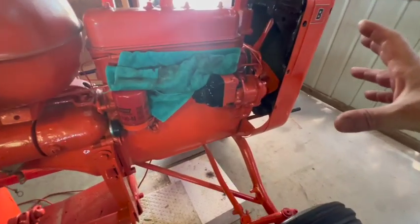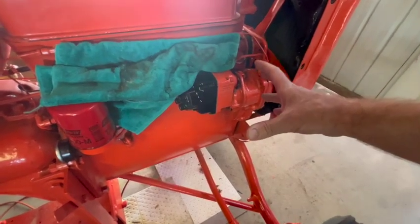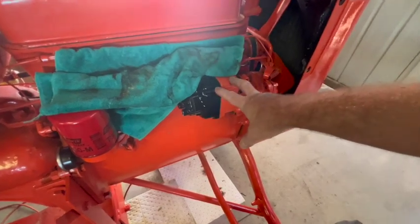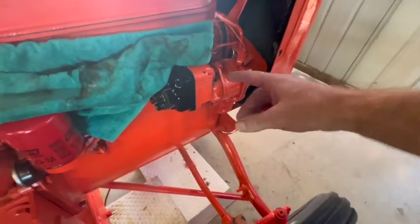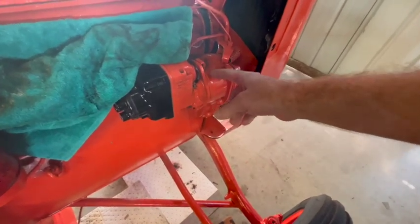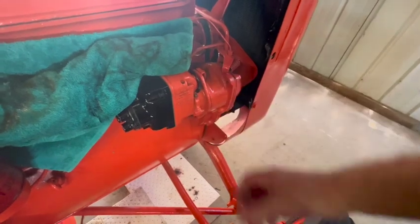So for the next video, the last thing to tackle, I think, before we get this running, is the ignition system. I need to remove the magneto. I need to verify that it's actually installed correctly and clocked properly with the internal drive gear here. I have a suspicion that that might be off.